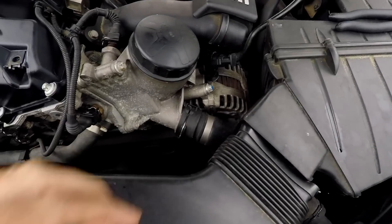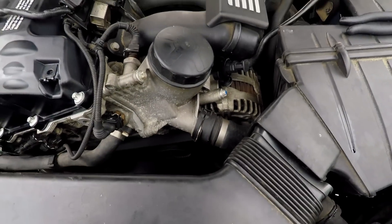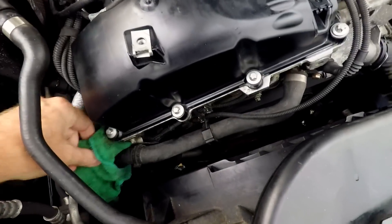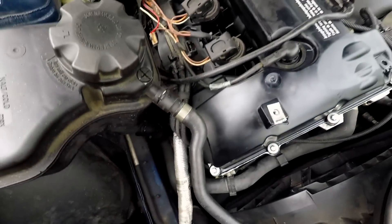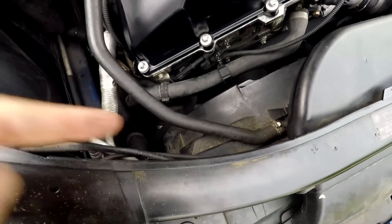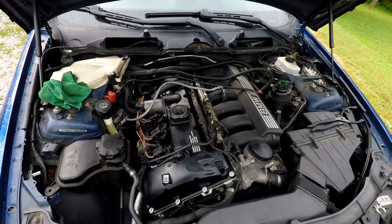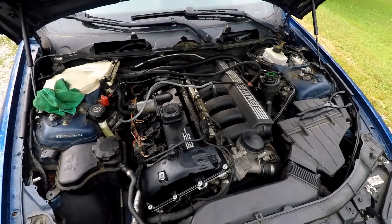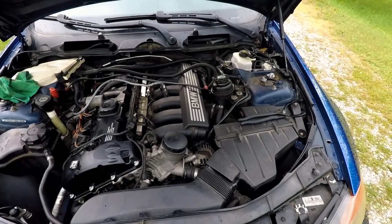Look at your radiator hoses. Can you see heavy white residue under the hose? Has it been dripping? Does the belt have oil or coolant residue on it? Check out the hoses coming from the head going down to the water pump. Check the hoses coming from the expansion tank — squeeze them. Do they feel soft and rotten? You can reach under the car and check the hoses under there. Squeeze the hoses going to the water pump. Has the water pump been replaced? If the car is getting around 100,000 miles and the water pump has not been replaced, beware — that's an expensive fix. If you can do it yourself it's about $150, but if you have to pay a shop, it's probably around $1,000.